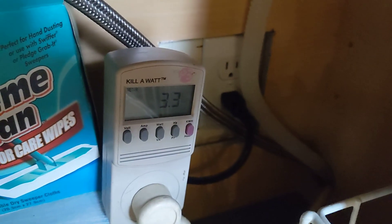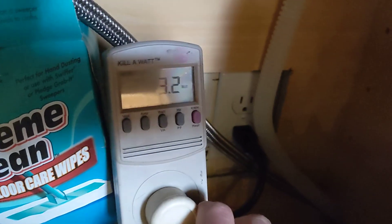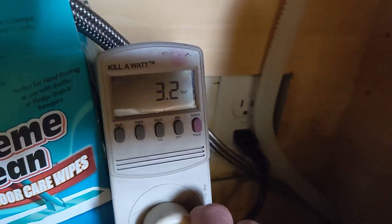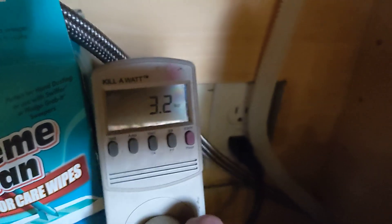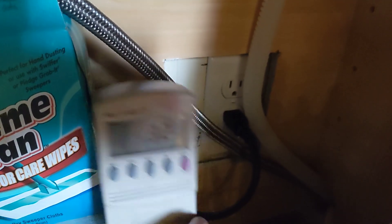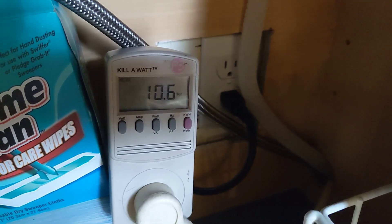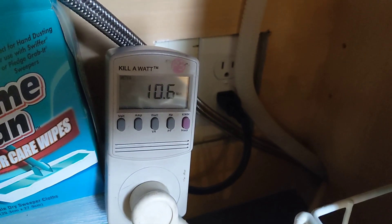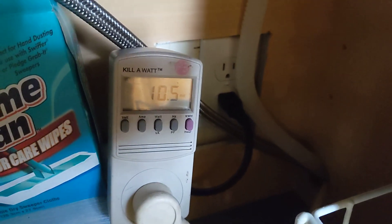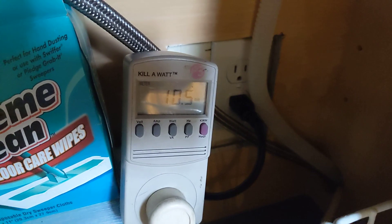So now we're going to begin another fill of water. Right now there's nothing running except for just the controls — the pump is off, all the other parts of the machine are turned off. Waiting for it to start the water fill cycle. We're only using 3.2 watts on idle, when everything's idle. Now we're filling it up with water — the solenoid to fill with water uses about 11 watts. It's hot water coming in from the water heater downstairs, and we're going to see if the machine actually adds heat to that water from the heating element on the bottom.